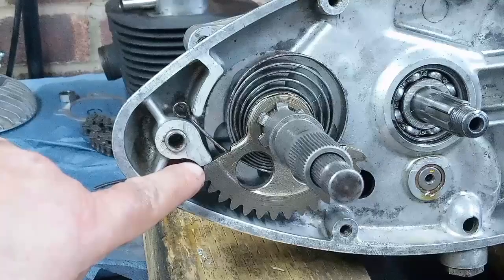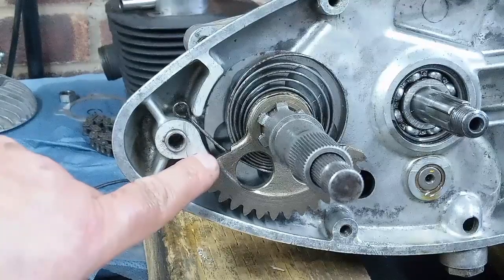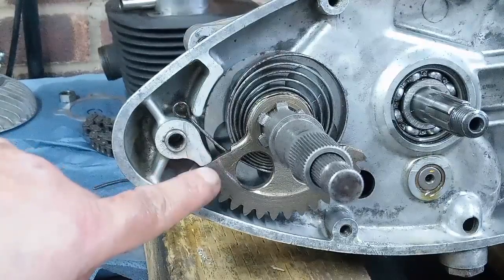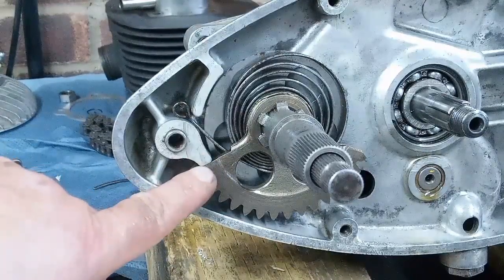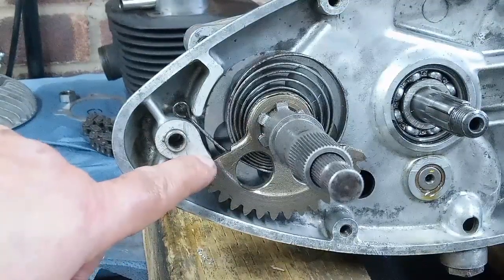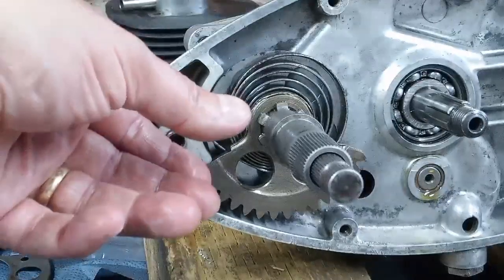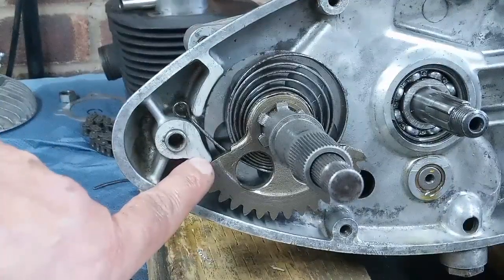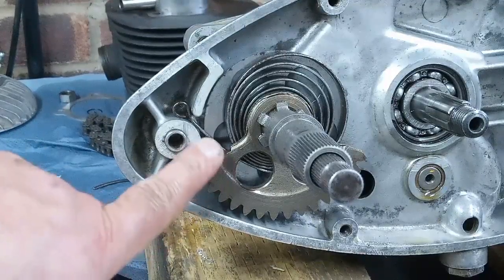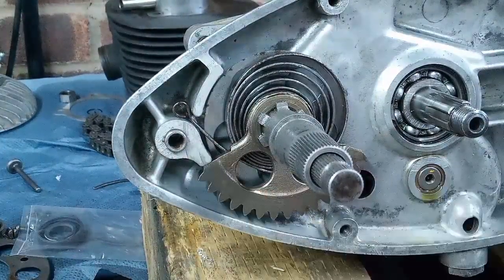And then the end of your ratchet sits against this stop here, and this stop is subject to wear. I've seen this worn. One of my viewers actually contacted me because his was worn. He was having problems with his Kickstarter. We had a look over email, and his casting was worn away here, so he had to rebuild all that back up again. What happens is the Kickstarter just starts creeping, and eventually it gets stuck. You press your Kickstarter and you can feel it rubbing against here and not working properly. So that's another one to look for, any damage here.